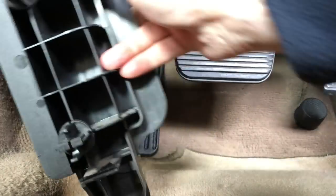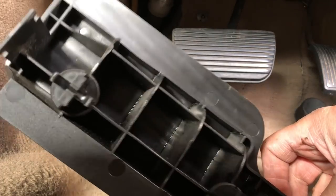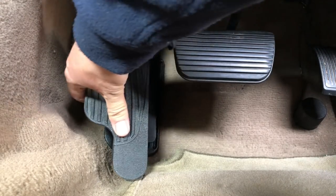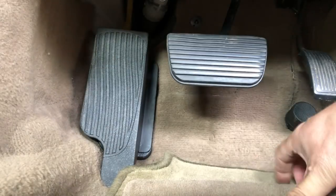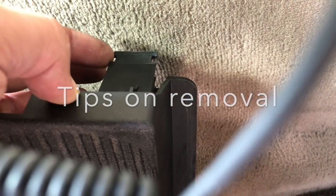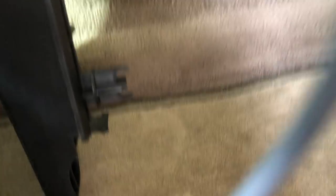So there you go - you have the choice between the two pedals that were included with your car, unless a dealer or somebody else has already removed one and left only this one. But most of you will have this one in place. Short legs, long legs - both equally accommodated and thought about by Jaguar. This should have been part of the tailoring experience when you picked up your new Jaguar. On mine, I find it easy to reach around this side - you're just disengaging it from two little notches - so it hasn't got to move far. Once you're off them, pull back and then you're just pulling those two plugs out. The bottom latch, once you've got the top out, will probably jiggle itself free anyway.